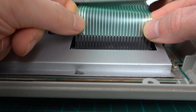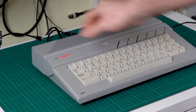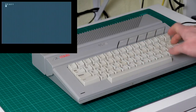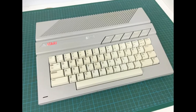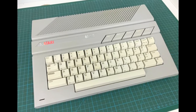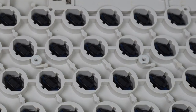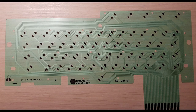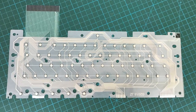Now that we're done with the board, let's plug in the keyboard membrane and test everything together. I'll turn it on and... oh what? Nothing works! Not a single key works! Remember how I told you the XE computers were kind of new to me? Well, this is when I learned that there are two kinds of keyboard types — ones with springs and these kind of black bottoms, like the one we have right here, and some other ones that don't use springs and have more of a rubber cap. The keyboards with springs use a single layer mylar for a keyboard membrane, whereas the rubber cap keyboards use a mylar with two layers. And guess what? I got the wrong membrane.